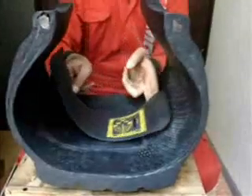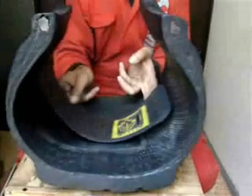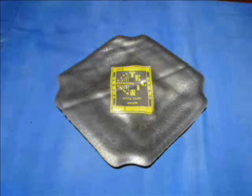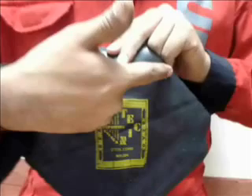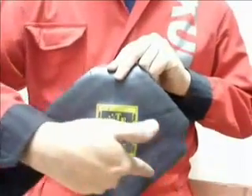Additionally, a gas-proof layer of rubber is incorporated to prevent migration of air into the repaired area. The crossply reinforcing section patch has layers of plies at right angles to each other, with a rubber covering on both sides.